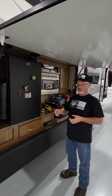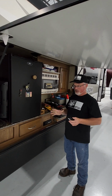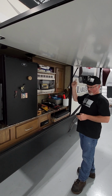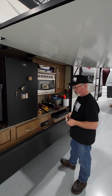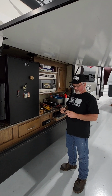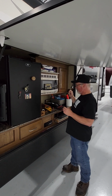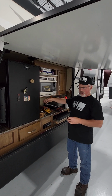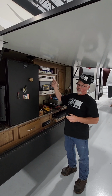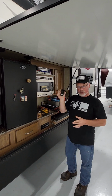Then you kind of start to trace where they wired this thing, and there's no logical rhyme or reason. They go up and in and around and twist, and it's process of elimination. There's not that many breakers, just test them. So once I found the end of the circuit, or at least where there's an issue, I ended up at the back of the trailer, and this is what I found.